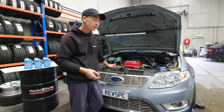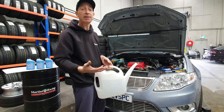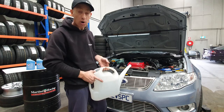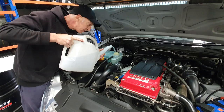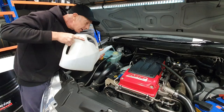This is not distilled water. Yes, in a perfect world you should use distilled water — you can get it from any part shop cheaply enough — but I don't use it. My belief is that modern coolants have enough good chemicals in them nowadays, and with a strong enough mix, distilled water doesn't really matter because the glycol has an inhibitor in it to stop rust, which is what you're trying to achieve with distilled water. So modern coolants will stop the rust for you. This is just plain water for the first flush — we just want to get any remnants of that cooling system cleaner out of the system, along with any old coolant that we didn't get out before.